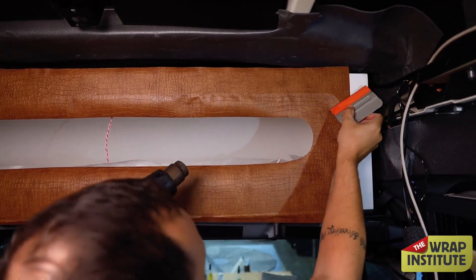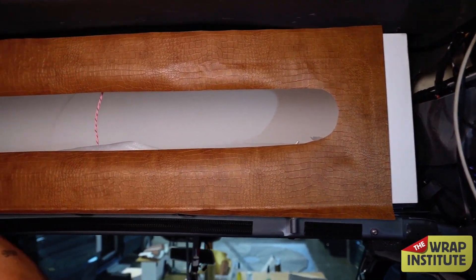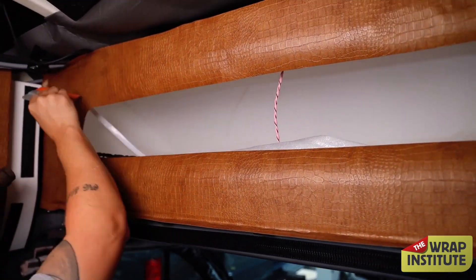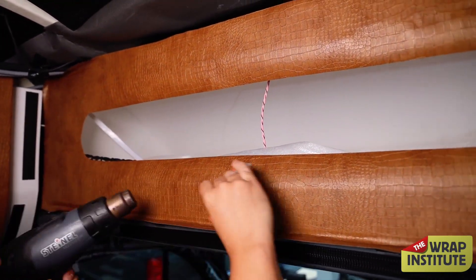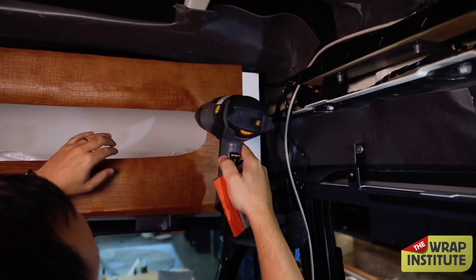The chance of overstretching this film is extremely high because the surface energy is medium to high and those angles are very severe with thick film. It's very important to get this sequential order right. He heats the film, sets it up on the edge, and now he's going to feed one of the mouths.